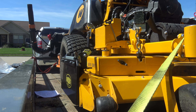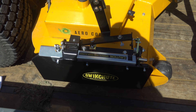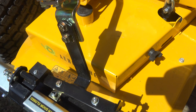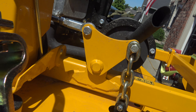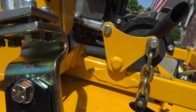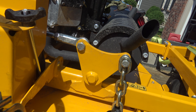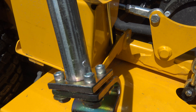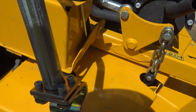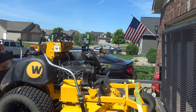There we go. After we get the four bolts tightened down to attach the handle, now all we have to do is tighten down the handle pivot part and get it in the position we want. I like mine as close to the gas tank as possible so I don't have to bend over as much. So right here works for me. Washers go on the bottom, and tighten from the bottom. Put these rear ones in first — that way you can get a wrench in there to tighten it while you hold the top with an Allen key. Done and done.